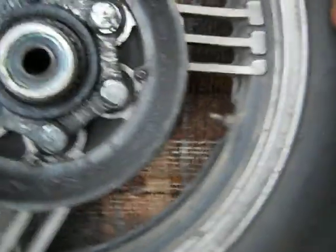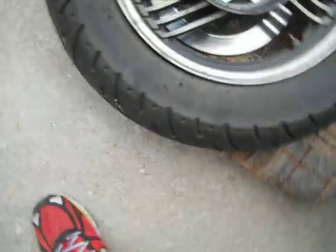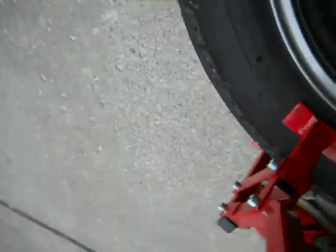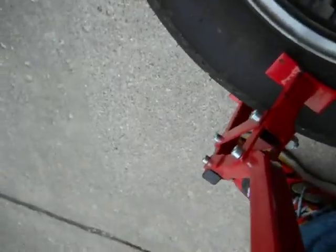Now, see this going on like that right there? Look at it. I could probably do that with my foot and snap there. But you just break it loose like that around there. Okay. Now see how I protected my wheel from that? Now I'll just flip it over and do the other side. Okay. Watch this. Just like that right there. You want to keep it away from the rim. Kind of work it. So that little arm on that bead breaker goes like that.